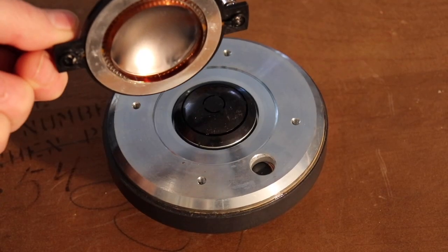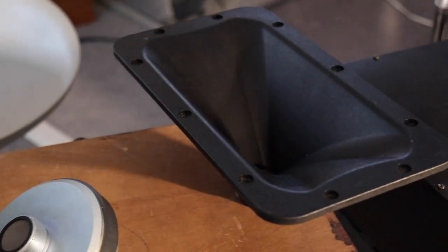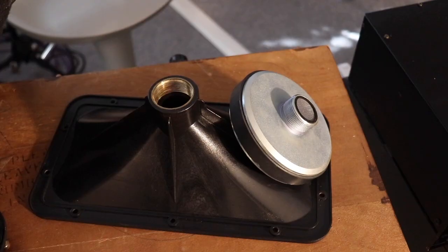It's really the only moving part — that little diaphragm. This one is blown, but it's very simple to just pop it out just like that, and then it screws right back onto the horn and you're good to go again. The parts are usually pretty easy to find and not that expensive, because horns are very commonly used and they're coming back more and more in home audio systems now, just because they work so well.